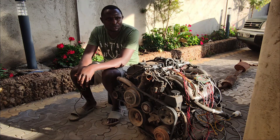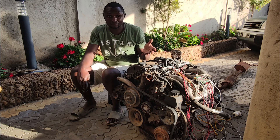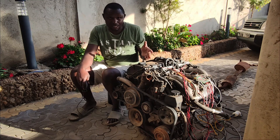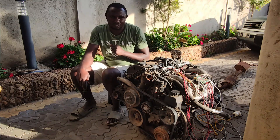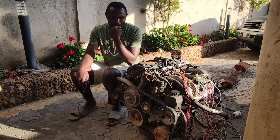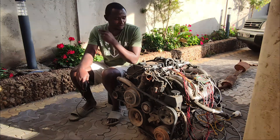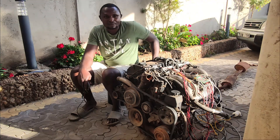I had so many questions, wanting to find out what could I have done wrong with my fuel system. I was fueling at the right time — I had confirmed that a number of times. I was injecting fuel during the intake stroke of the four cylinders, so I was correct. I leaned it out to the least possible fuel I could inject through each cylinder — it didn't work. That day I was kind of discouraged, but I never gave up. Two days later I was doing my research trying to find out what could have gone wrong, and then it hit me.